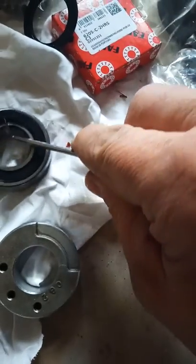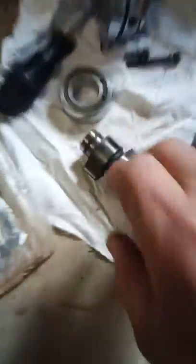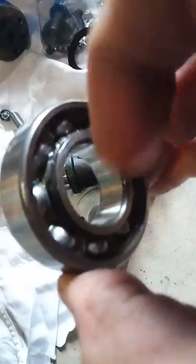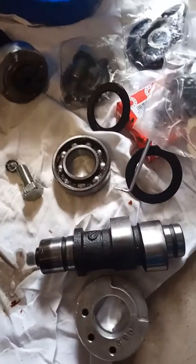Some people do one side, but I'm thinking we need some oil to go through this bearing. The cam is hollow — that's the oil feed for the back. The oil for the front is here, but it'll be sitting underneath this part, it'll be the inner race. So the only oil going through will be what's flying around inside there.